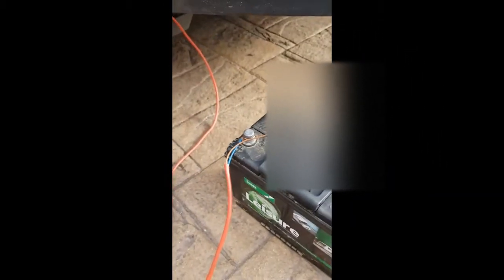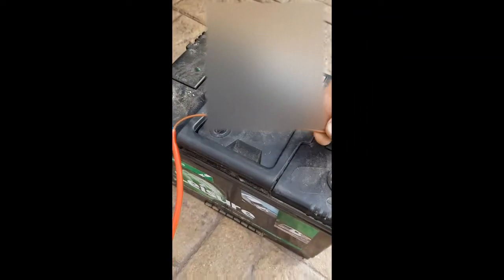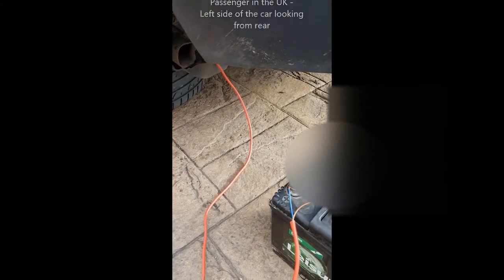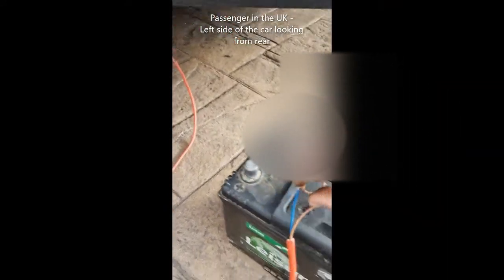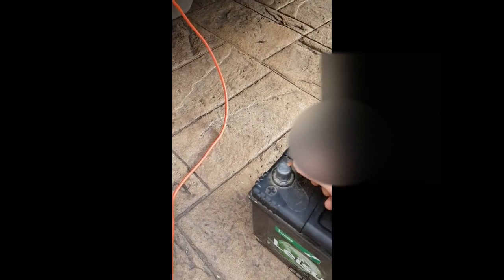We've got a battery here. Remember the handbrake's off at the moment because we took the brake off before we put it to sleep. We put blue on positive — so blue is the back of the car — and if we touch it to the front, the front one's negative. So blue, the back of the car, is positive. That put the brakes on — you heard it change tune at the very end. It's very important you don't go past that tune or you'll wreck the motor. So we've established that putting the back terminal of the caliper — this is on the passenger side — to positive makes the caliper put the handbrake on.